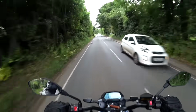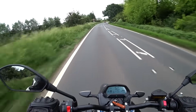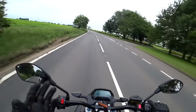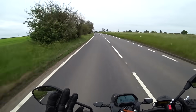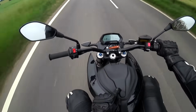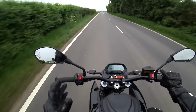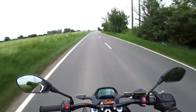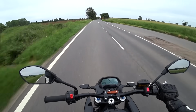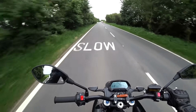Okay, now coming back to this handy little storage cubbyhole here, we already know that the range of this bike is between 80 and 130 miles, but you can do some things to both increase the range and decrease the charging time. That's where, for the most part, this little cubby hole comes in. If you sacrifice this cubby hole, you could install in here instead the Zero branded supercharger unit, which will give you a 6 kilowatt charger, which means that you're going to be charging 6 times faster than the 1 kilowatt charger which is built into the bottom of the belly pan of the bike.